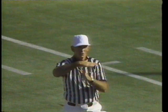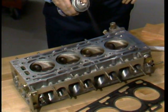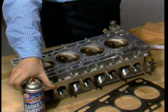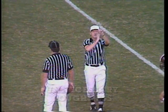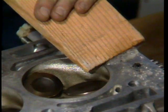There's another area we should talk about before proceeding. Let's interrupt our teardown process and turn our attention to the head and block surfaces. Start with cleanup. For this engine, we clean both the head and block mating surfaces using an appropriate chemical gasket remover suitable for use on aluminum, such as Permatex 4MA. Be very careful here. Even for stubborn areas, make sure you never use a conventional gasket scraper on any aluminum components. Aluminum cannot withstand this type of treatment without getting damaged. To be safe, use a soft wooden block for the tough spots.